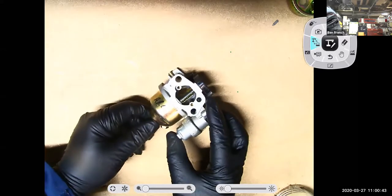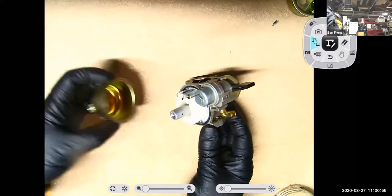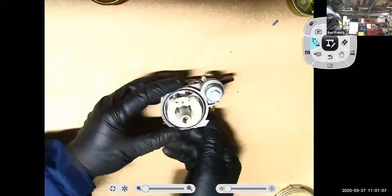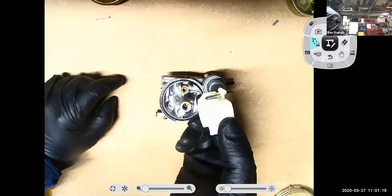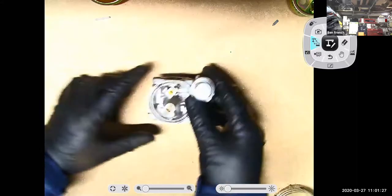All right. Okay, well, that's great, that's on a couple of big carburetors. What about a little carburetor? Like Nathan and Jonathan, a lot of my small engine guys will like this. Here's a little carburetor off of a Honda clone motor. My float bowl is this brass colored part on the bottom. I've taken that off, and here I can see my actual float pontoon, and you can see how it drops down, and then it would raise up and plug the needle in the seat. In fact, I'll take the float hinge pin out of it. There's my float and the needle, and you can see that the needle has a rubber or Viton tip to it. And there is the seat for my float.